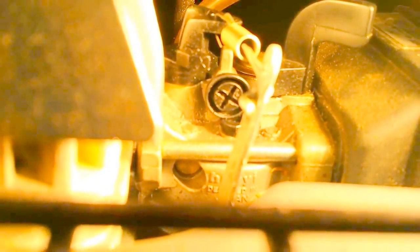You have to pull that plastic plug out when you go to clean the carburetor. Because there'll be an adjustment screw behind it. You have to pull that out, and of course make note of how far the little screw is adjusted out.